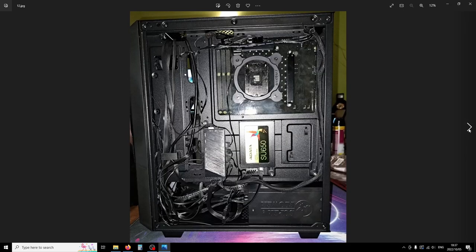Here's a photo of the back — it's spaghetti, but you can see the fan splitter coming from the pump with the two AIO fans connected. The four ARGB case fans are plugged into the controller hub. The PSU is mounted fan-down as standard, though fan-up would be possible since the PSU shroud is vented. There's actually a lot of depth room behind the motherboard tray, but not a lot of integrated cable mounting points — just one small plastic clip that doesn't offer much tension for holding cables.